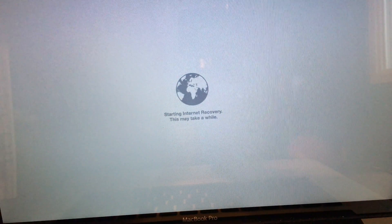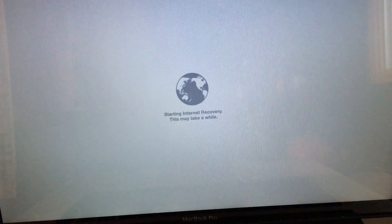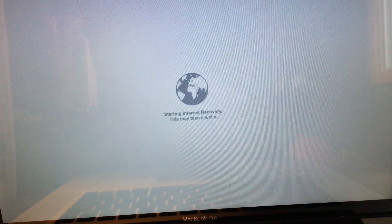As you turn on your Mac for the first time, make sure to press Command+R. I'm pressing that right now — this is the first time booting to set up our new SSD. Hold Command+R until you see a loading bar. It really depends on your Mac how long that takes, but just keep pressing Command+R and you should be fine. Now I can see it's doing an internet recovery.